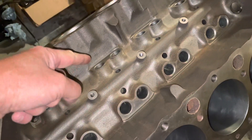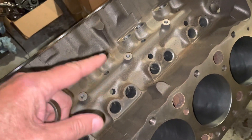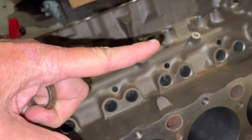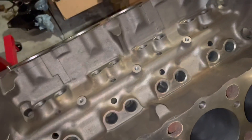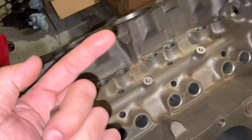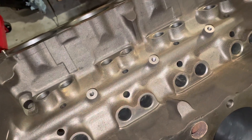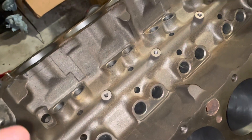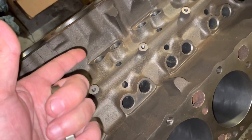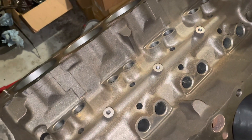The alternative was what's called a flat tappet lifter — just a lifter with a flat surface on the bottom. The flat surface rides on the cam, and even though it's called flat, the bottom of the lifter has a little bit of convex curve to it, and the cam lobe itself has a slope. The lifter is not riding in the center of the cam — it's riding off to the side. As the cam lobe pushes up on the lifter, it's pushing on the outer edge, so it tends to make the lifter spin. You want to see the lifter spin in a flat tappet system, but in a roller lifter block they don't spin. The spin is because it's a combination of sliding friction and rolling friction — it's not quite a full roller, but there is some rolling of the lifter as it spins across that lobe, which helps reduce some friction and wear. Even so, they're still notorious for wearing out within 100,000 miles.